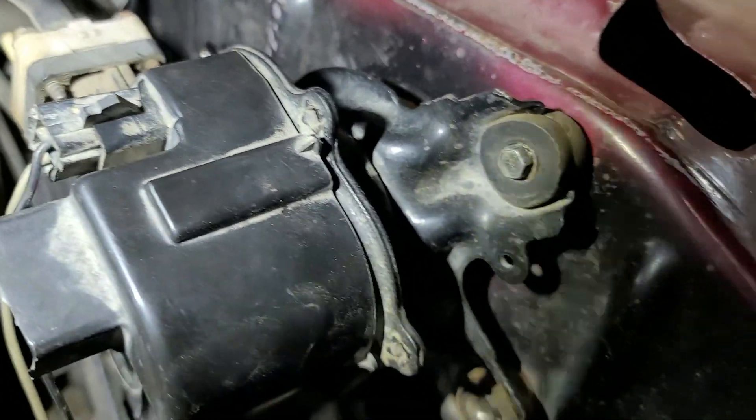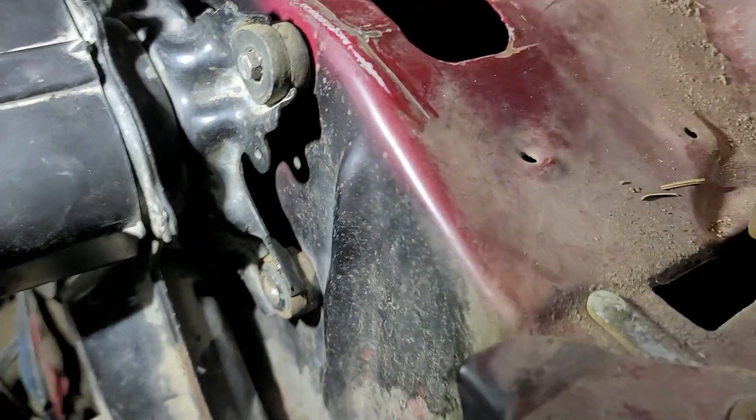I got it knocked down a little bit more. I've got a couple bolts in so I can check it. You can see down here — kind of hard to see — but you can see that's kind of the position it should be in to park. It's on the right side of the motor on its way down a little bit. If yours is on the left side of the motor, that's 180 degrees off, and that's where it's sitting now.